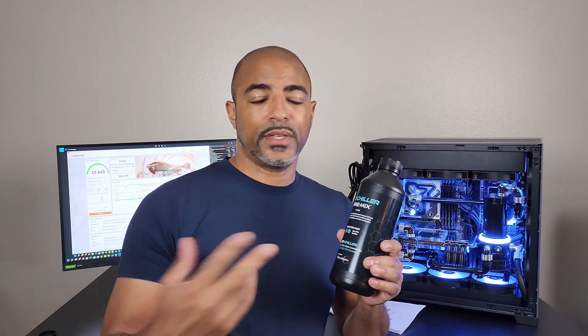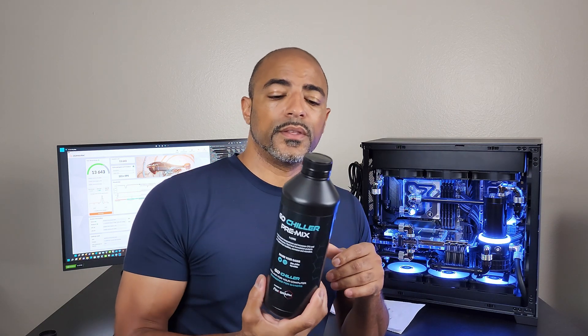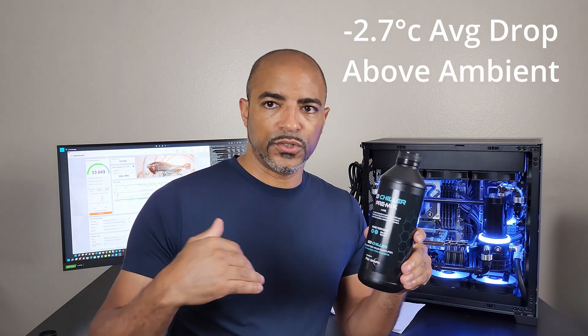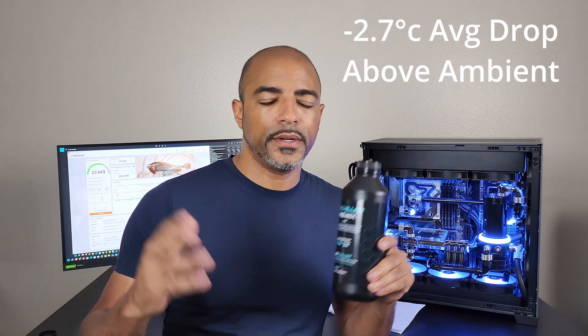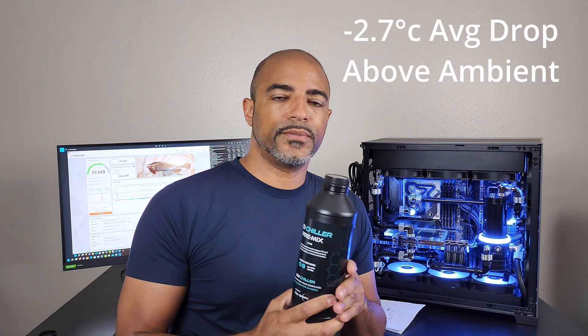We have the interesting conclusion to the GoChiller — is it worth it? Does it adhere to the claims? In a way, yes. I ran Cinebench R23 single-pass and 10-minute pass, Blender Benchmark 3.1.0 and 3.0.1 for the 3090, 3080, and 12900K, plus Time Spy, Time Spy Extreme, Fire Strike, Fire Strike Extreme, and Port Royal — all run numerous times. Comparing the GoChiller graphene fluid to the distilled water / EK CryoFuel mix, temperatures dropped on average about two and a half to three degrees Celsius, taking ambient temperatures into account.